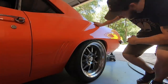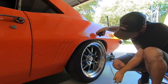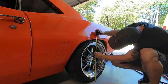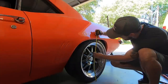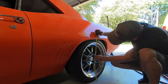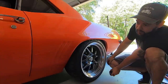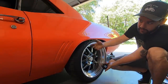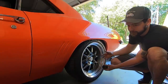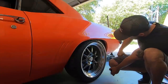I put it back down and to my naked eye it looks exactly the same. We measure 23 and three-quarters — so that's only an eighth of an inch gain. That's not going to be enough. I'm looking for more like 24 and a half; I'd like to go at least another half inch higher. That would also make it match the front stance. I have the front set a little high on the adjustable coilovers because I want this car to be drivable — I don't want to scrape exhaust on speed bumps or go super slow in parking lots.